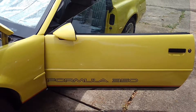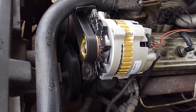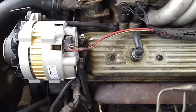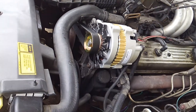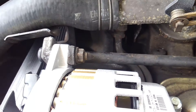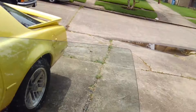We are back with the finished result of installing our new alternator on this Formula 350 that was getting some really crazy voltage load variations. The old alternator had tested out good, which didn't make much sense. We've got the new one installed — third gens are actually quite easy to install an alternator on. You've got one bolt here, one bolt there, a torx head with a captive screw on the back, and another one there, so it's not a complex job.